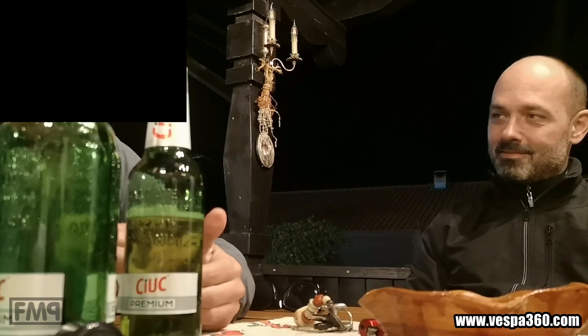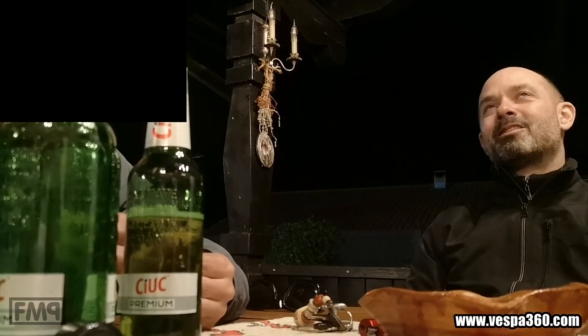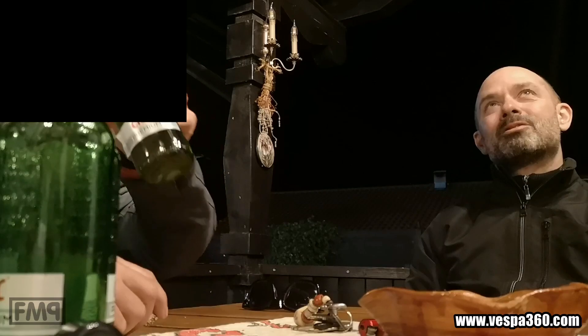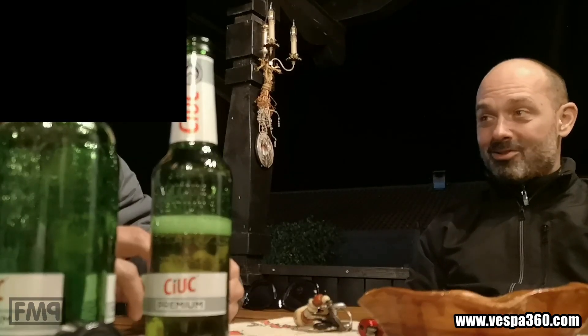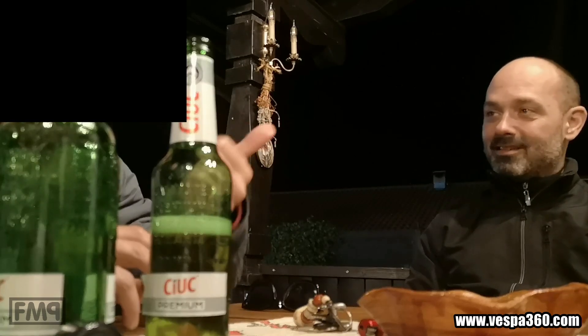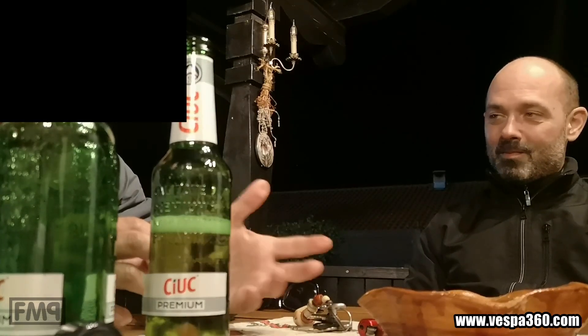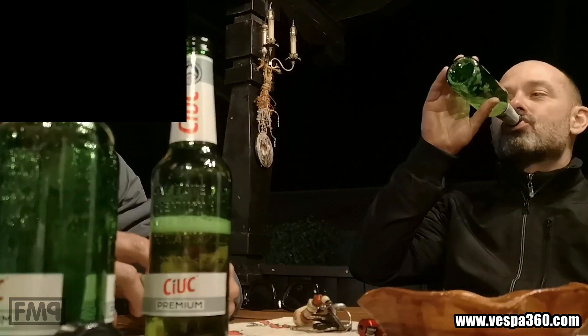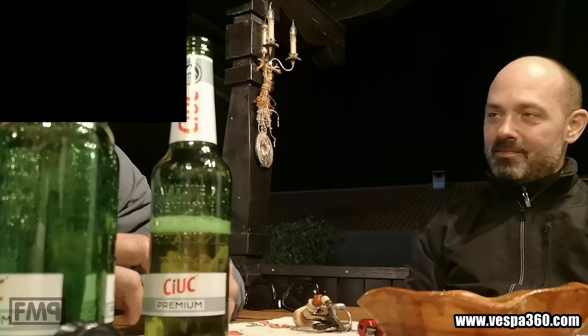With the cylinder before, it would only pull around 7,000 comfortably uphill, or even six and a half, because the power was lower down, so it could get a bit dangerous on faster European roads. Your bike is good now — you've got a hill or headwind, you drop into third, and you can still do 80–90 k's. I held it today at 7,700 RPM up that big hill behind you the whole way — a couple of kilometres long — and it just purred up there.